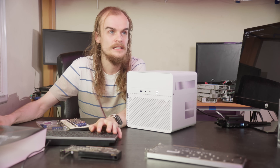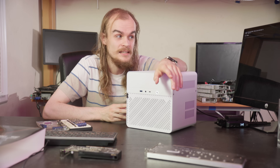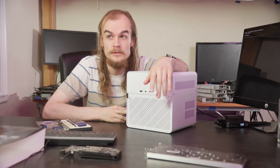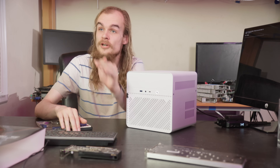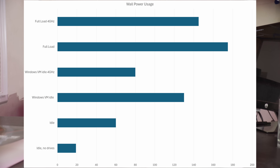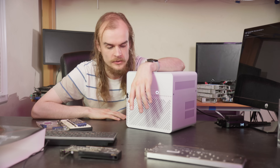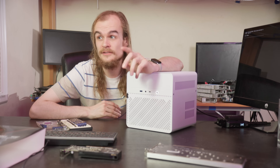Just for fun, let's try full load power consumption. With mechanical hard drives installed and all CPU cores pinned with stress in Linux, the system runs at about 4.4 GHz on all cores, pulling about 175 watts from the wall. Running my script to drop it to 4 GHz, the system drops to about 145 watts, which is a decent amount of power savings — especially at lower loads — for what is not a huge performance trade-off. So you're definitely taking a performance hit at the highest end, and it's something worth thinking about if power saving is your biggest goal.